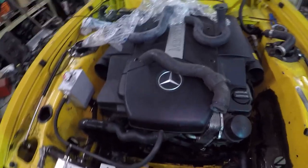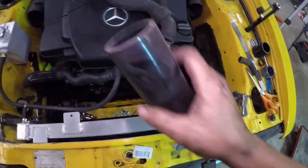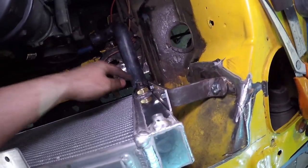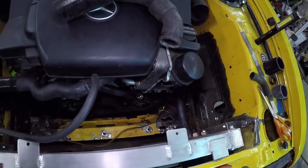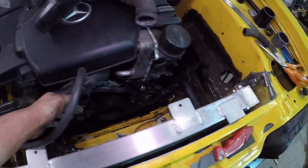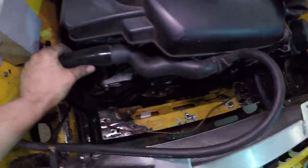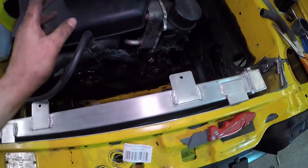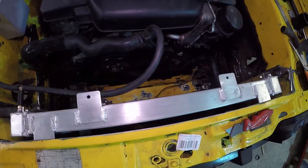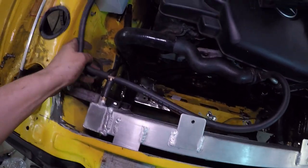This thing has been frustrating me — my plans did not work. My fancy U-bend and all that stuff wasn't going to work, because it was going to bring the hose up to a point where there was no practical way I could get it into the radiator. Plus it turns out my brackets are too close to my hoses for the radiator so I can't get the clips on. I've had to completely reverse my plans. Now the top hose comes out and goes down into the bottom of the radiator. The air bleed hose comes out and goes across under that panel to the radiator and then to the expansion tank.